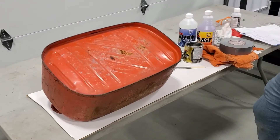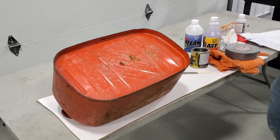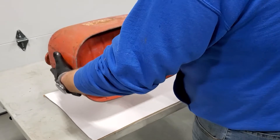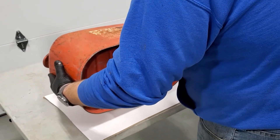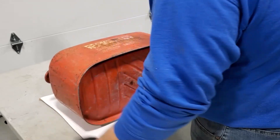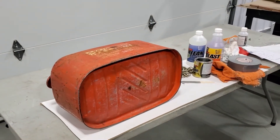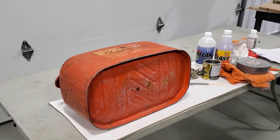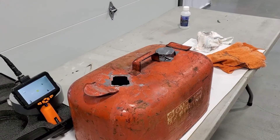It's been about 15 minutes. We're going to put it in a different direction — on its side — wait another 15 minutes, then move it onto its bottom, and so on and so forth until the tank sealer cannot move anymore. That is very, very important.